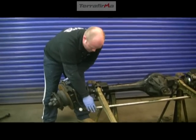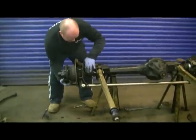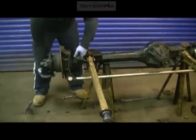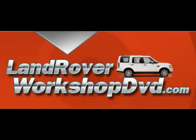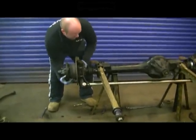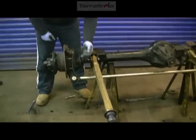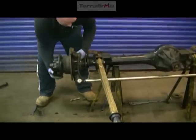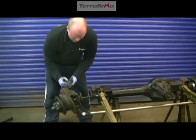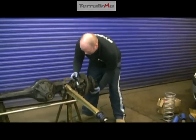The thing I'm trying to point out is you haven't even got to undo the steering arm — just the front steering arm. Once you've loosened that, it allows that to swivel round like that and drop down. So obviously this is going to be on your car. Same with this one.